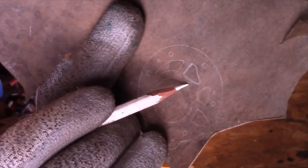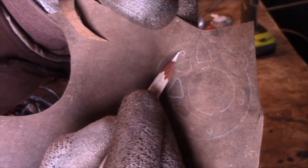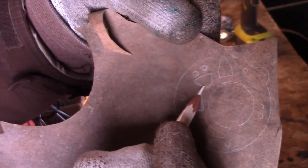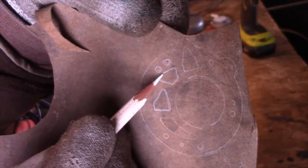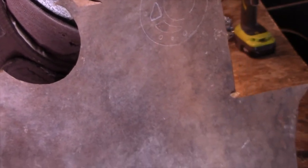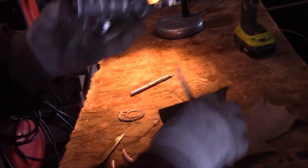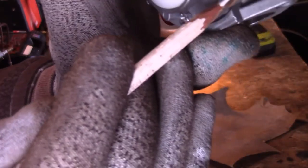You can't make it too big because right here in this area I had to go around this hole and this hole and this area — it's very close right here. There is a ridge on the carburetor part that runs through this area, and the ridge is there to make it seal even better. Anyway, I did cut out the gasket and installed it already into the carburetor — that gasket is right in here and you can see part of it right here.